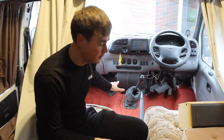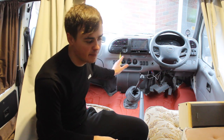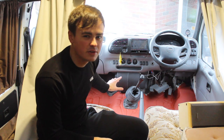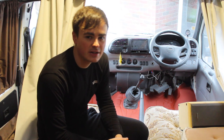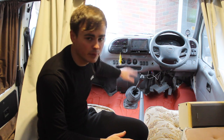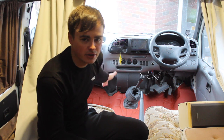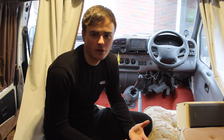I'm really pleased with how the floor's turned out up the front — it's got one coat of red oxide primer over it now. I've obviously welded in all the holes, treated all the rust, and then painted it with red oxide primer. It could do with another coat but it's a bit cold today and it's snowing outside. There will be a follow-up video where I actually locate where the water's coming in — I've got a good idea now — so I'll be monitoring it and then sort out the issue in an upcoming video. If you enjoyed this video please don't forget to like and subscribe. I aim to make a new video every week, so stay tuned and hopefully I'll see you next time — take care.